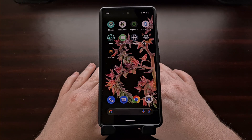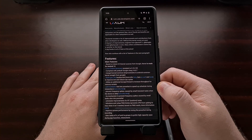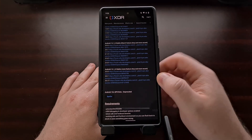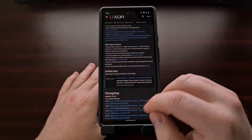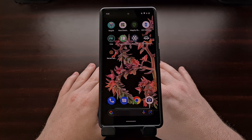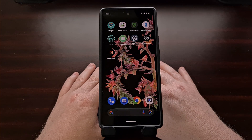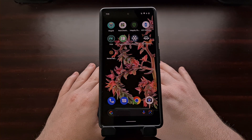Lastly, we need to download the latest version of the Kira Sakura custom kernel for the device that matches your phone. I'll be linking to the original post on XDA in the video description as well, because down there you'll find the download links for the latest versions as well as the changelog for each version that has been released. Be careful not to flash the Pixel 6 Pro kernel on the base Pixel 6, and don't flash the Pixel 6 custom kernel on the Pixel 6 Pro — make sure your download matches the device you currently own.